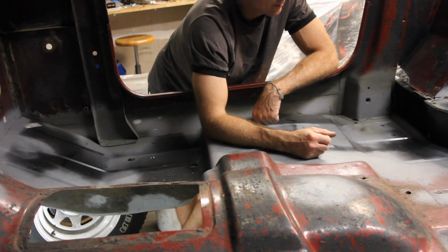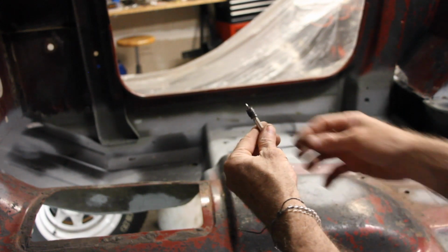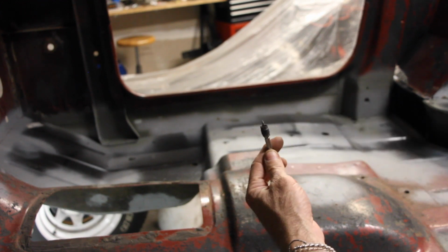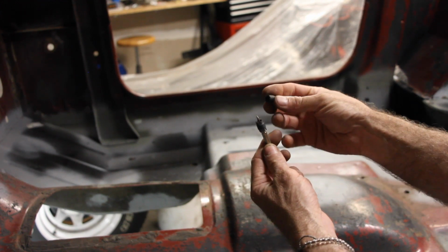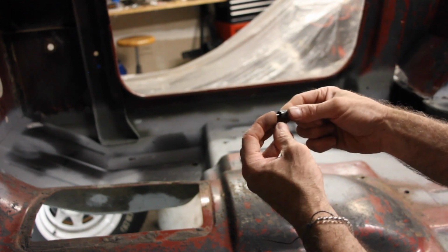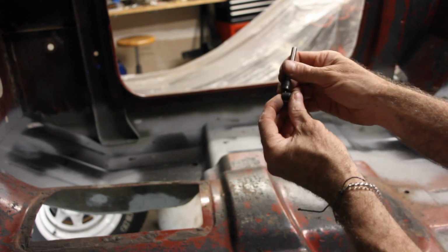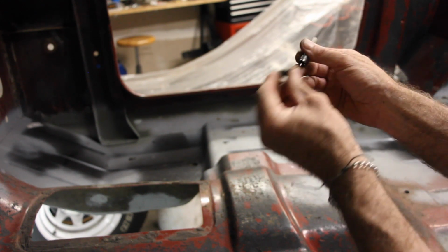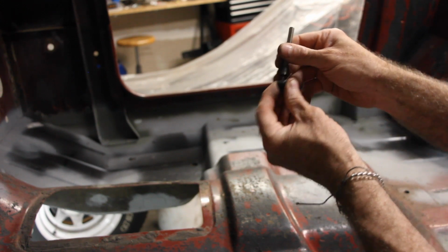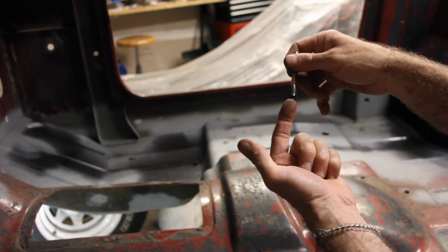I would recommend getting yourself a spot weld cutter. So this is a spot weld cutter. It's basically a bit that has these extra sleeve heads, these tooth heads that screw down on top of this thing. And then this has a kind of pilot point that's spring-loaded. See how it kind of goes into there. And then as you press down, this cuts out around the spot weld.